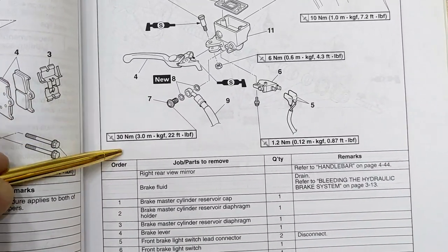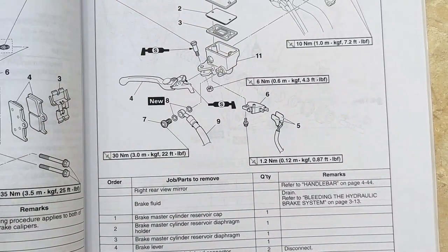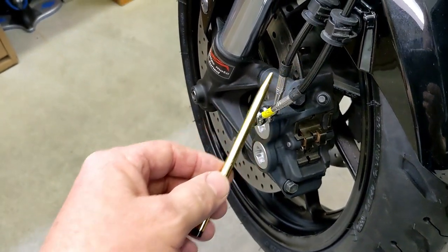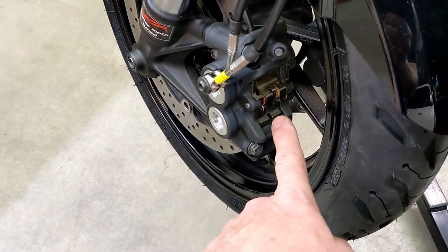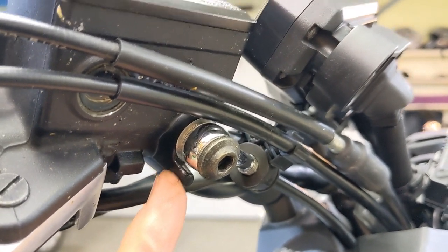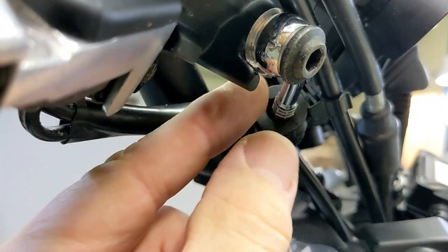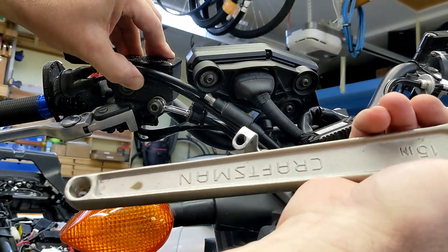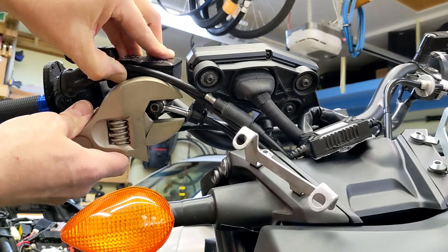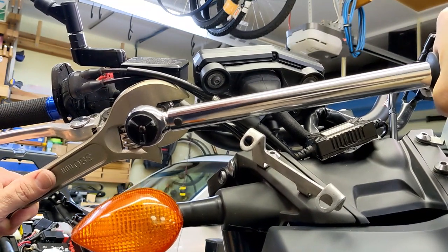The tightening torque on the brake hose union bolt is 30 newton-meters. On the next video I'm going to fill this up with fluid and show you how to bleed the brakes. After I get the brake fluid in, I'm going to tighten these two caliper bolts down to 35 newton-meters, but I want to get the hydraulic fluid in the hose first, because I like to squeeze the lever when I tighten these — that helps center the pads on the rotor. The only thing I don't like about these aftermarket brake lines is there's a little tang on the master cylinder that the stock lines bump up against, but this one just spins. I was able to use a big crescent wrench, make sure it was tight up against there, pivot it up, and push — and that's good.